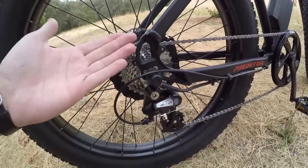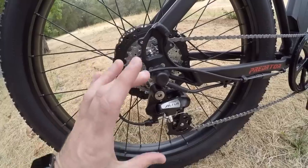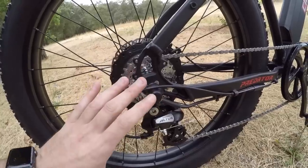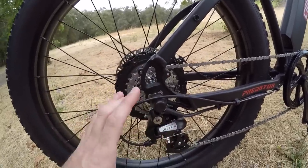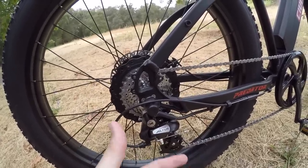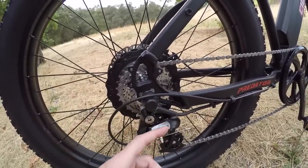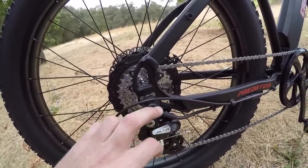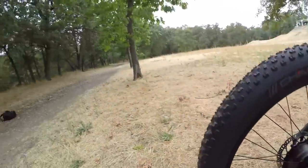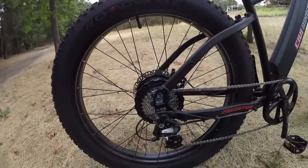What those derailleur cages do is they come out and then down a little bit, and they help protect the derailleur and the power cable from strikes. If I lay this bike over on the right, this can get damaged without that derailleur guard. Potentially if I hit a curb or a log going up like this, without that guard it's probably going to strike the derailleur and possibly even the power cable. So just something to keep in mind. Going back to the philosophy of use for this bike, it's going to be for moderate trails like this, not really hardcore stuff.